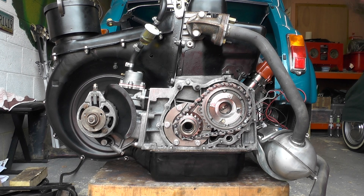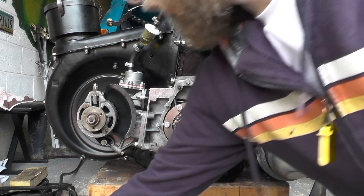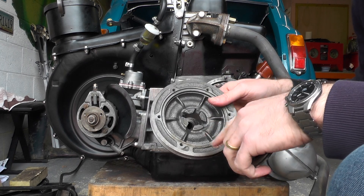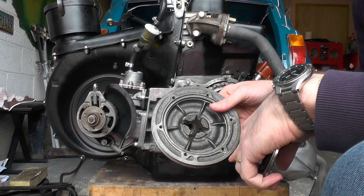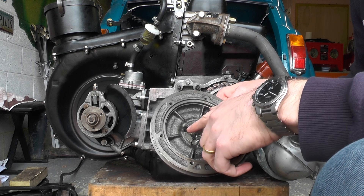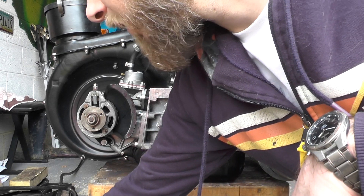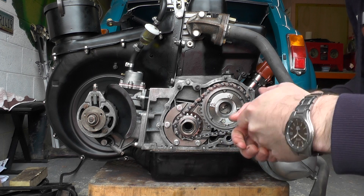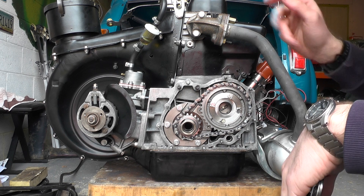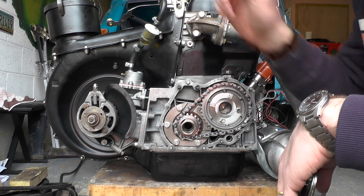Welcome back to the 500 workshop. After a long journey with our engine, we got it started. We had a problem with the oil filter pulley piece with the alignment, and when we swapped that out it turned out the timing could be better. We got it started — the distributor was 180 degrees out.